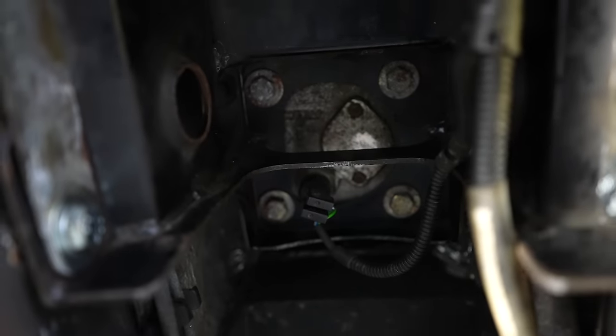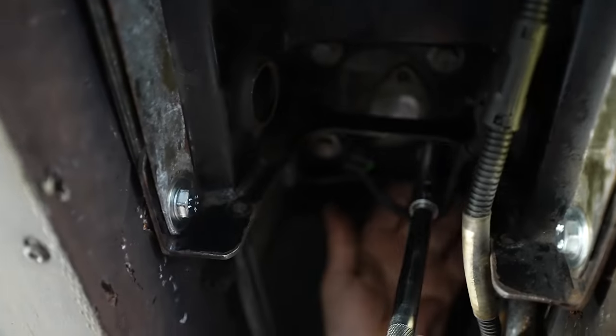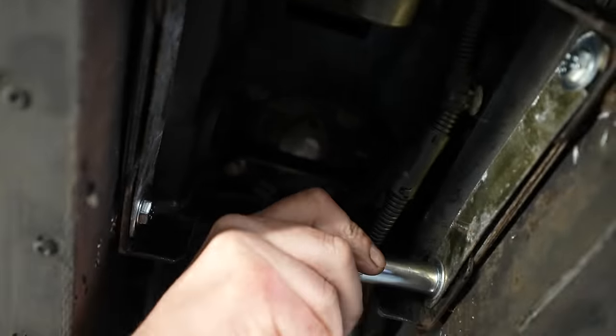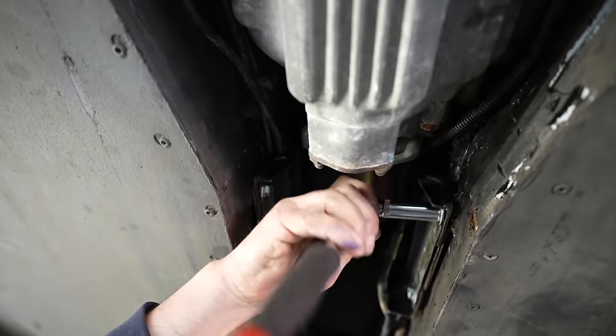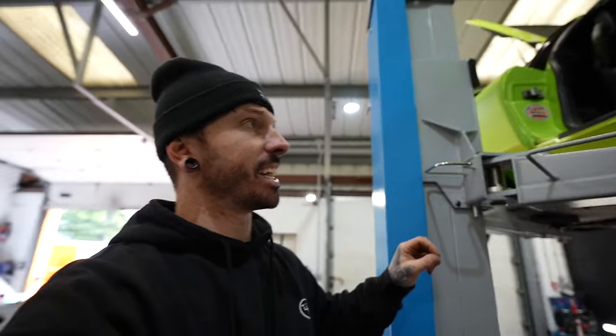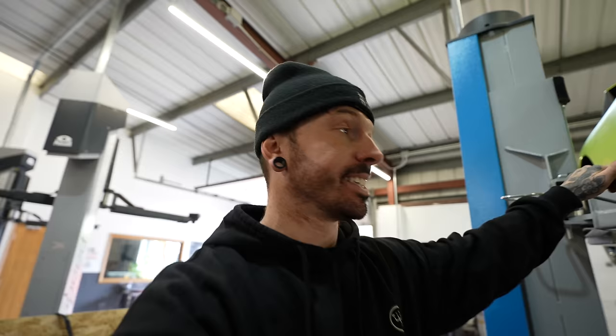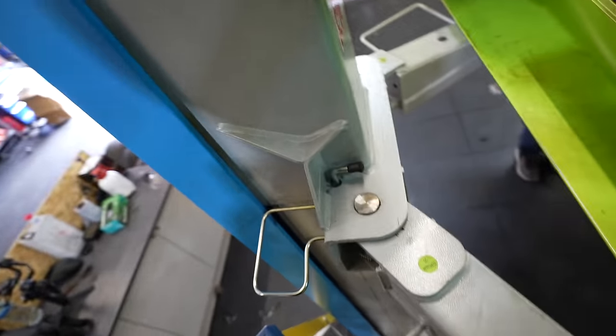There's four bolts which are underneath the lever. We're going to loosen them off along with some of the other mounting parts underneath. Then I'm gonna get inside. I'll go sit in the car now, try and get the gear stick in line, and then we'll lock it back in place. This might work, or it might not, but it's worth a try.